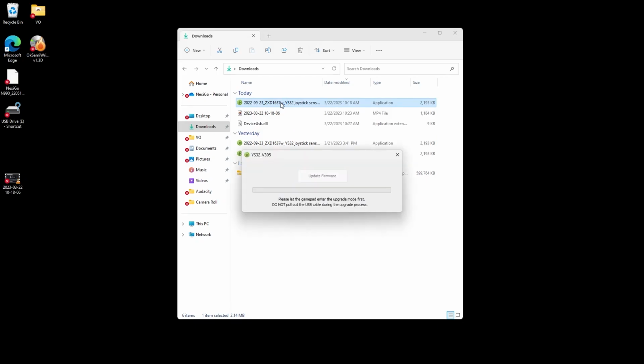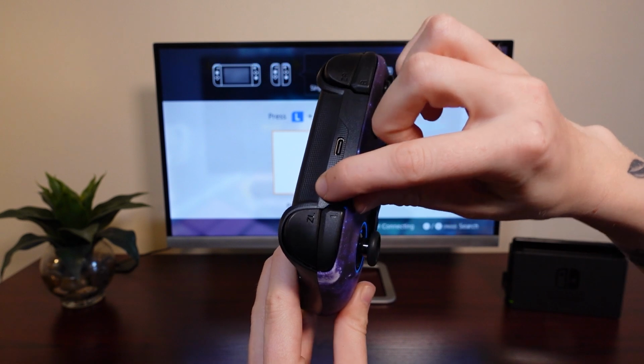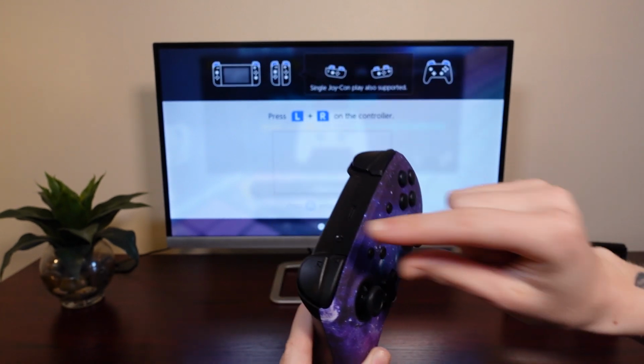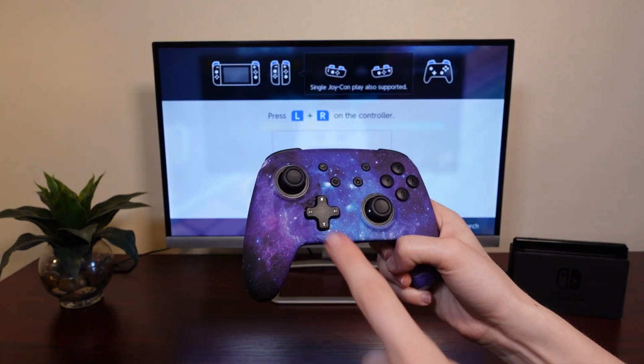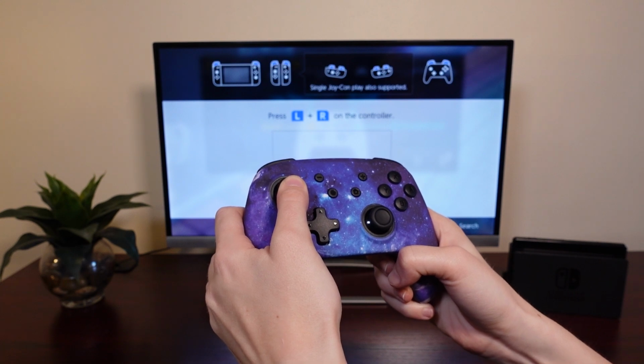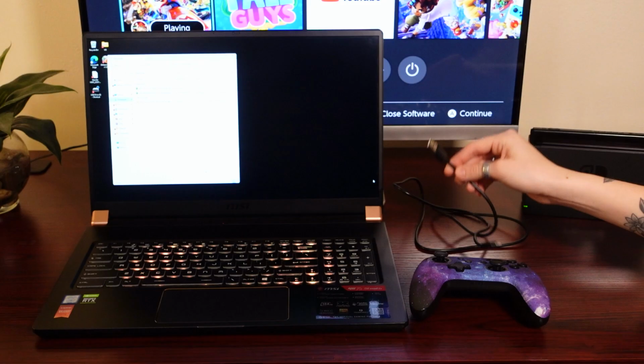To update your controller, first download the firmware tool onto your computer using the link in the description below. Next, power off your NS32 by pressing the small button next to the USB-C charging port on top of the controller. Then, press and hold the left thumbstick for 3 seconds to enter firmware update mode.